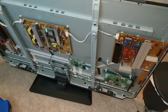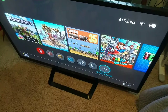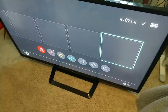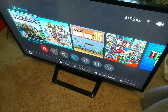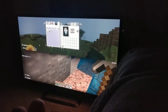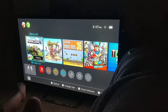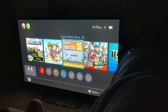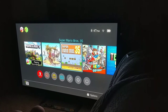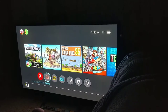Let's try it — everything's back together, clean and tight. So far we've been playing it and no blinking. We'll play it for another hour or more — see if there's any blinking — but so far so good, everything looks perfect. We've been running it for at least an hour. Go ahead and go to the home screen. And this is where it was flickering really, really bad. I haven't seen a single flicker since we did the cleaning and tightening of all the screws. It's working perfect — I think we have a positive fix.